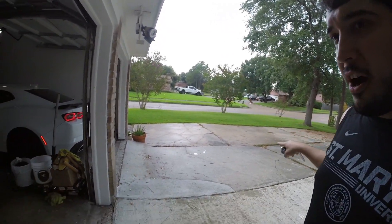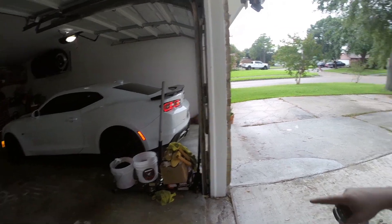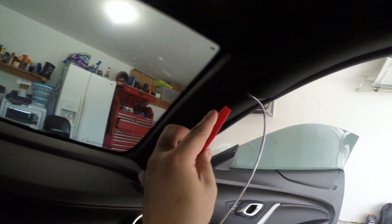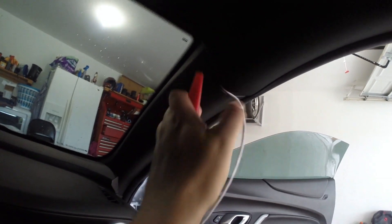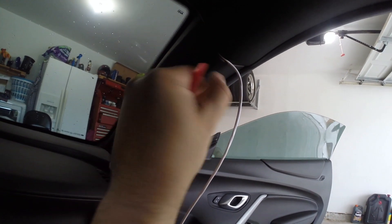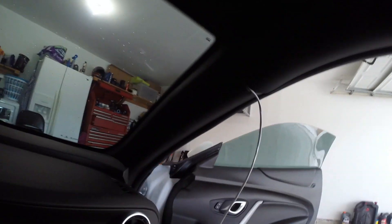Because it's raining, I pulled the car out and moved it to the other side so we have access to the passenger side door — we need to be working with the door open. When going through here, basically what I'm doing is pushing the wire in as much as I can and then finishing it off with a slight little tug of this plastic tool to really get it to pop right in without having to remove any panels.